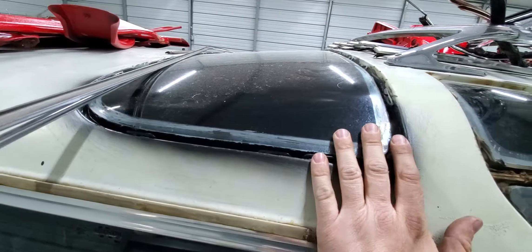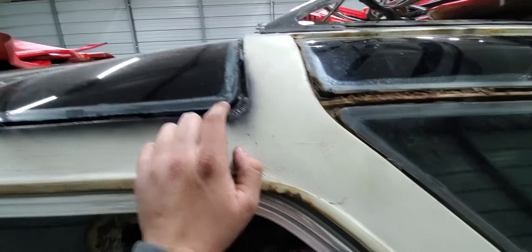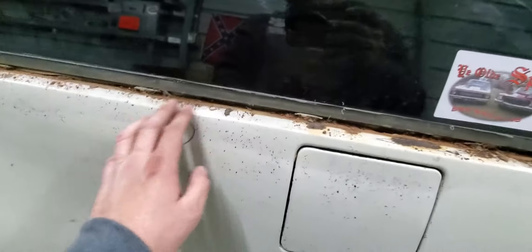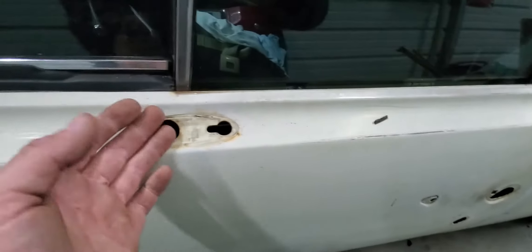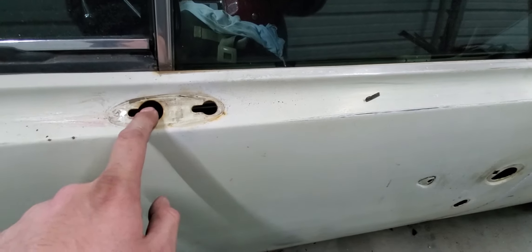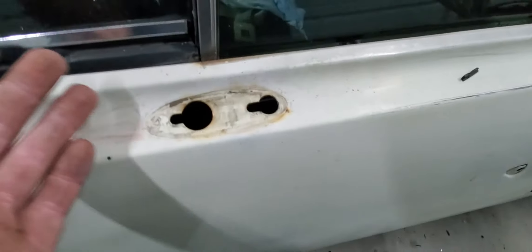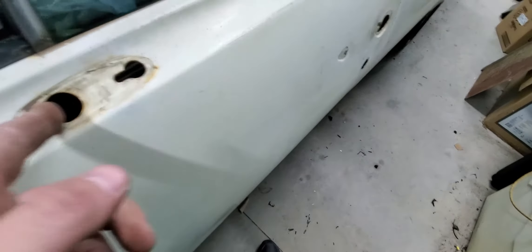This here is just self-explanatory, just like a back glass on a Monte Carlo. This is a real trick though — a lot of this chrome was in mediocre shape, so I might have to have some of it refinished. For this mirror, you loosen these Allen screws — I think you loosen them from down this way — and then take the end of a wooden hammer, hit it a couple times, and it'll slide out of the slot and come off. Mine broke on the floor, so don't do that.